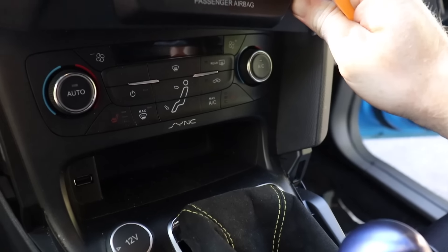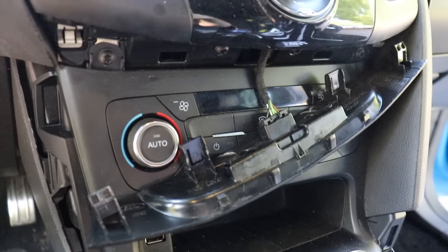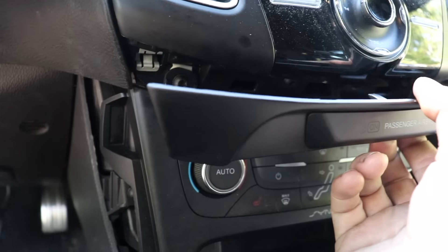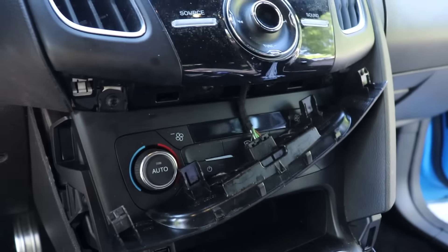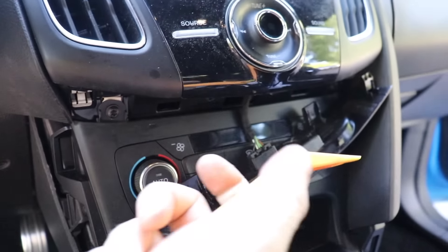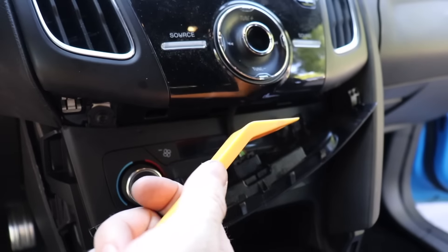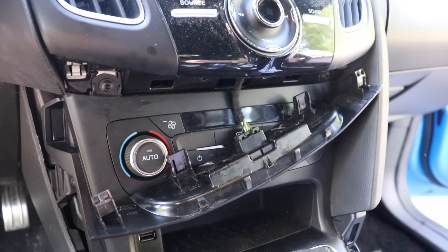Now that is out, just going to unplug and then get the rest. So you have one clip, two, three, and four. What you want to do is start from the left side, pop the first one out, and use your pry tool to get in there and pop this second one out — then these two will release. Don't try to do it all at once. I did that for about 10 to 15 minutes and it did not work. Start on one side and the rest should pop out from the other side.